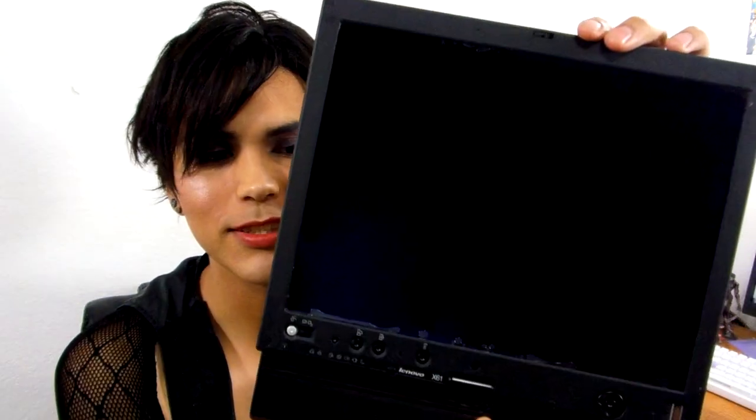This thing does get a little bit hot. The Wi-Fi card in here is pretty bad — you have to do the Middleton BIOS to remove the whitelist on it, and then get a cool-running Wi-Fi card. I think the Intel 6200 is pretty good. Otherwise, this is a pretty solid laptop. I've got a 120GB solid-state drive — I believe it's a Patriot Pyro SE or Patriot Fire, something like that — and I've also got 4GB of RAM. This is the SXGA+ resolution model. There are some bubbles on the bottom of the screen and up top. You don't get that with the X60; you only get it on the X61 because they put a new kind of glue on there for the digitizer so it can be nice and sensitive.